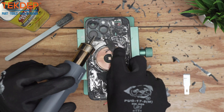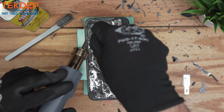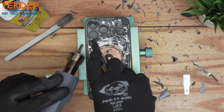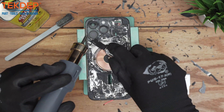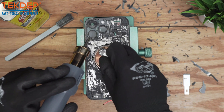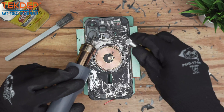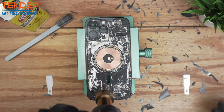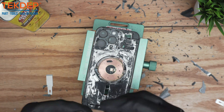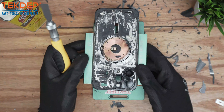One key thing to note here is that even though there isn't really a lot of glue in the lens camera area, it's because the glass is sitting under the mid-frame bezel of the lens. The best way to approach it is to try to pull instead of breaking. You want to find the perfect angle where you can pull it instead of breaking it. Always try to adjust to a position that makes the repair easier, even if you have to flip it.